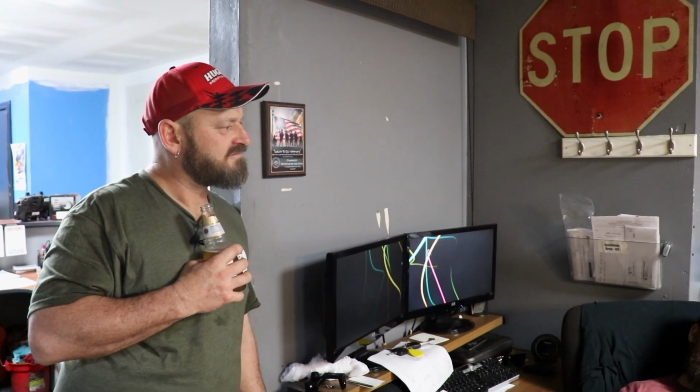It's crazy. So it's Friday. We back here tomorrow or what? Yep. Back tomorrow. We got the fuel cell in today. We got it plumbed. We got all of our boot plumbing done. We made our fuel cell cradle, or Al did. So tomorrow I'm going to run the -8 and -10 from the back to the front, and we'll P-clip all that to the floor, and Al's going to start wiring. We're going to run our engine loom through the firewall. We're going to run our battery cable in the cabin.